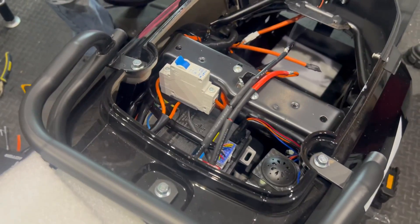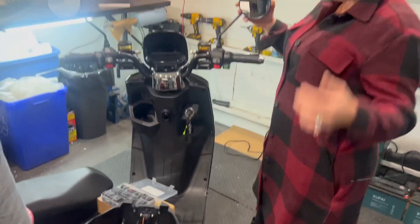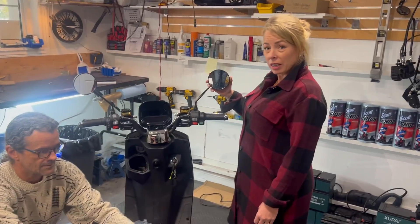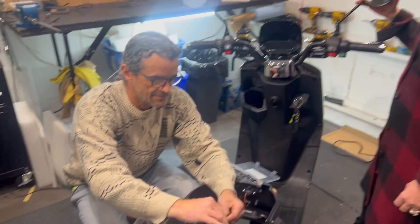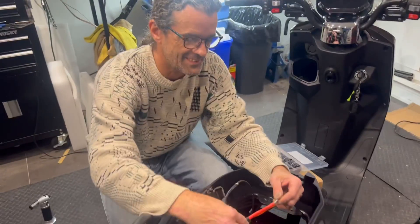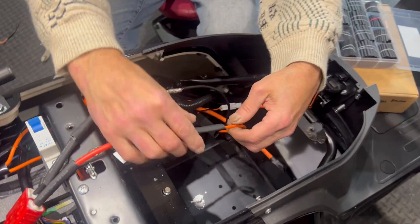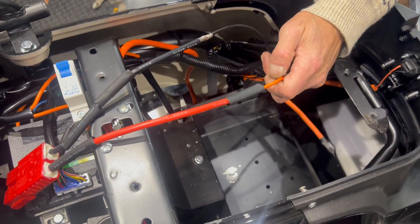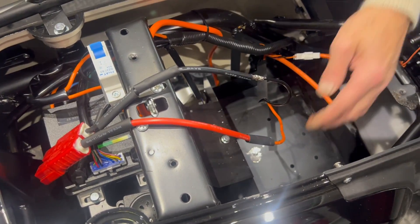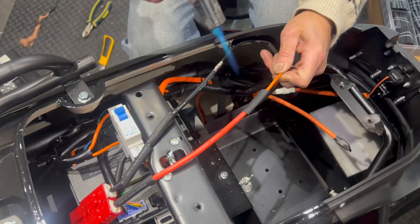Let it cool and put your shrink wrap on. We'll pause and then show you how to do the shrink wrap — because why not? So on the main wires, this is actually double wall shrink tubing, but I double shrink tube it anyway. Just do your shrink tube — stay back — and you can just watch it shrink up, get all around it.